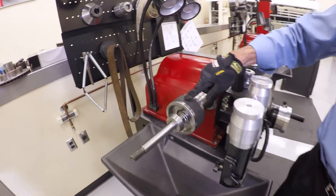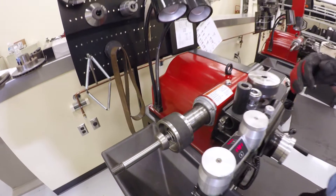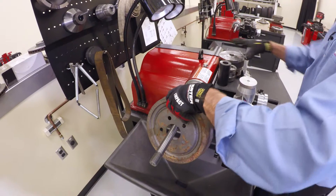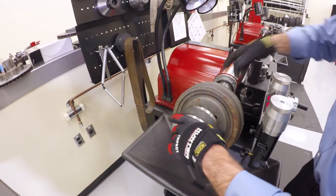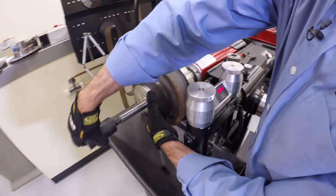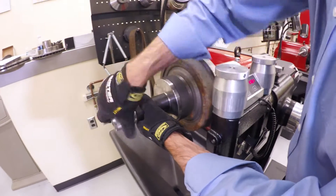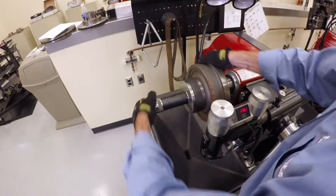The difference is that we have our two cups. I'm using this smaller cup now on the back side of the drum, and the reason I do that is because I want to make sure that my drum bar can fit in between here. So I'm going to place my drum on the arbor, then my larger cup goes on. I'm going to lift it up, center it, make sure it's centering on the cone. Put my spacer on, quick nut — turning to the left to tighten that up. We're tightened up and we're ready to go.